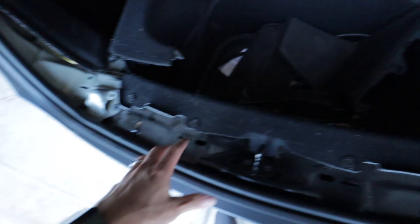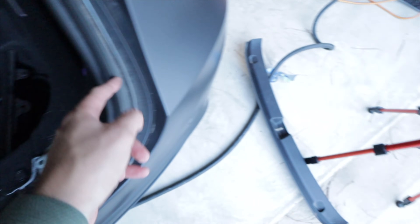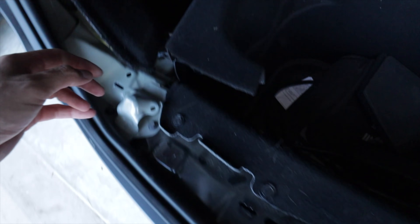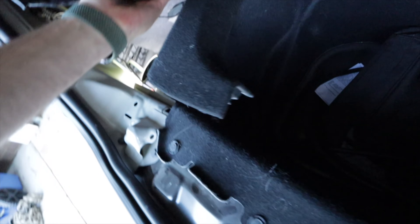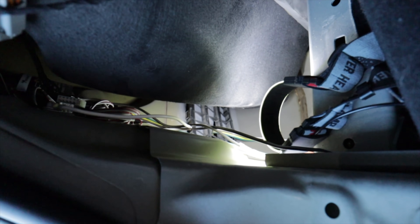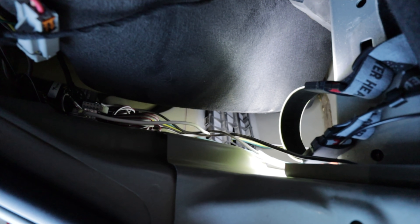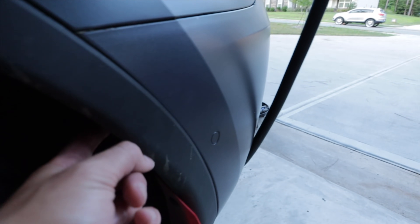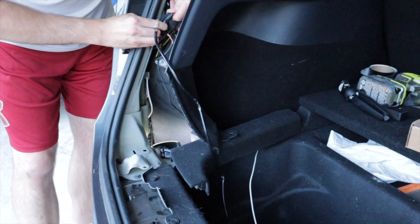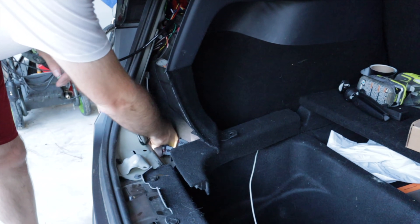This plastic piece just lifts up, and if you have a metal clip that stays in there, it's stubborn — you have to pull that off and put it back on before you clip it back down. With this out of the way, it can hinge just a little bit. If you fold this around, you can see there's that vent right there, and there's a wire sticking through there. That's where I have my trailer hitch wires going, so I'm going to feed right through there, right next to that. Once we push the wire through there, I'm going to pop off the inner liner and find that wire. So I'm going to connect these wires first, and then take the wire and fish it through.